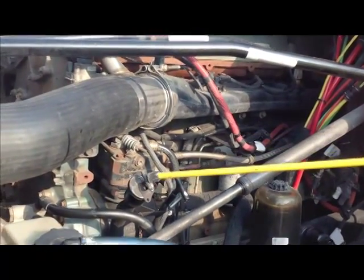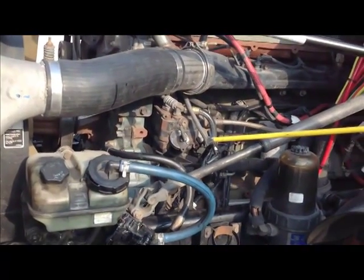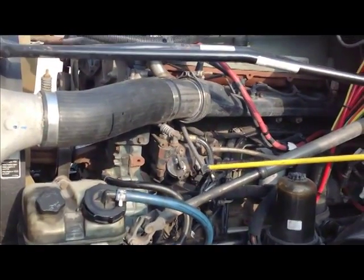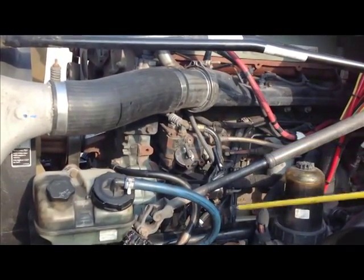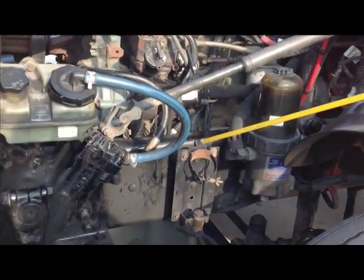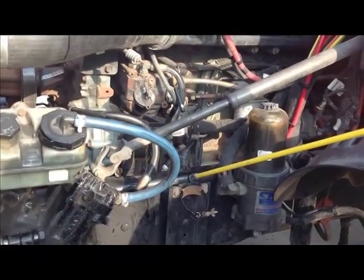Now I'm gonna come to my oil fill and my oil check. You will not physically check the oil at the DOT test. In the real world, of course, you will. Now I'm gonna go to my frame. We must do the frame on both sides. It is straight, not bent, no unauthorized holes, no unauthorized welds.